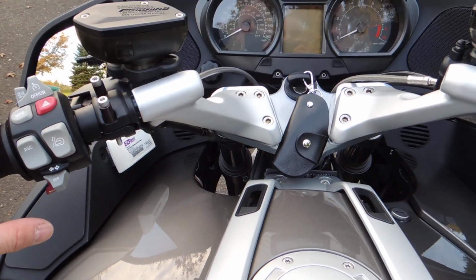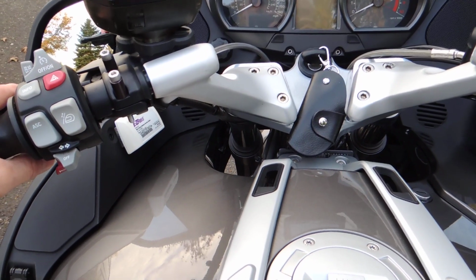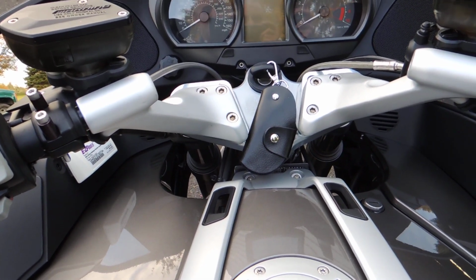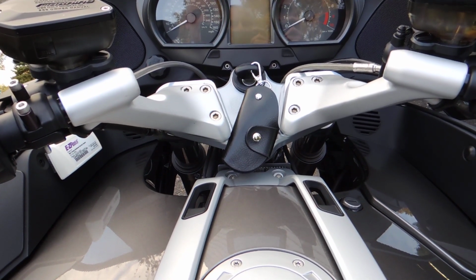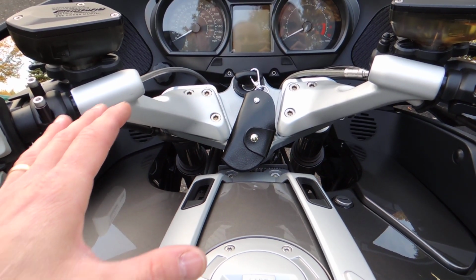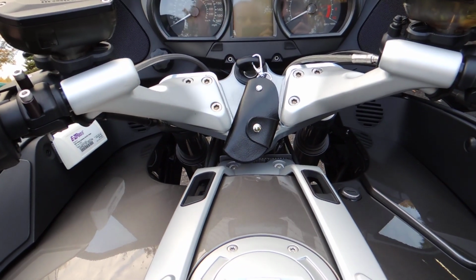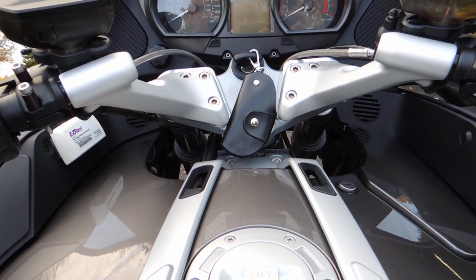Now, with these bar backs, my God, I'm just like on rails. Wherever I want to go, I just point and I'm there. I now have a little bit more bend in my elbow than I had before, and that really makes all the difference. I have just a little bit more reach, and I don't have to move my shoulder in order to stretch. Even stops made a big difference, because before, again, I must have been stretching my shoulders forward, moving my body rather than just my arms when I had to do a hard stop. Now my hard stops are more confident and definitely straighter.